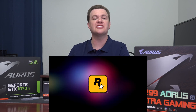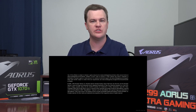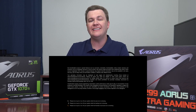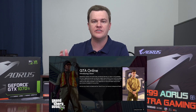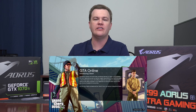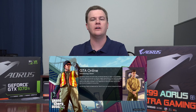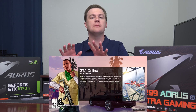I did a game launch speed test — I'll show you that footage here. I launched the game to see how long it took to get to the main menu, then timed from clicking on story mode until you could actually control your character. Why Grand Theft Auto 5? Because that game notoriously takes forever to load. The reality is it's not a huge difference. I've now tested that on several different drives — it really doesn't make a huge performance difference which drive you use, because most of that is sequential, and there's a lot of CPU, RAM, and processing in the background. There's no perceptible performance difference to launching GTA 5 on either of these drives.